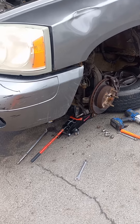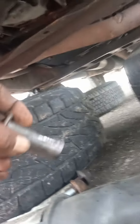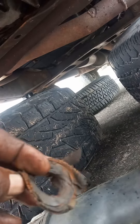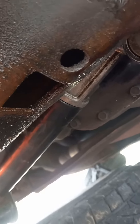I took the tie rods loose, went up under the car, took the rack loose right where the bad bushings are. As y'all can see, these bushings go bad — the rubber part in them goes bad, they get torn all up. So I just grabbed the bushings off the other rack and put them on here.